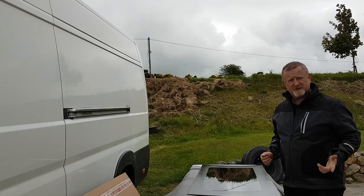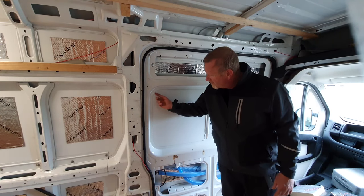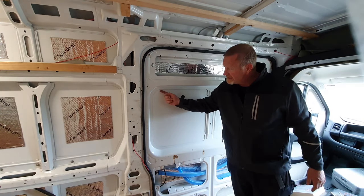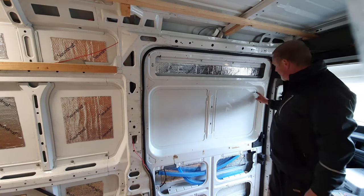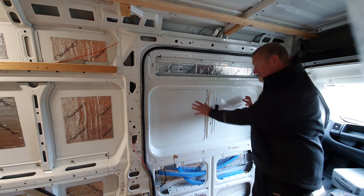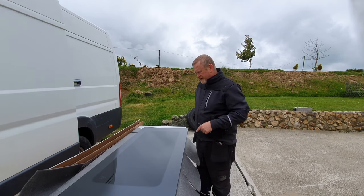So let's have a look at some of the options for cutting our holes in the window. From inside the van we can see we've got a skin here and all the way around. The simplest way of doing this is making a hole here, here, here, and here with the hole saw, and then cutting along this line, cutting across this panel, taking the panel out, and then we're ready to go.